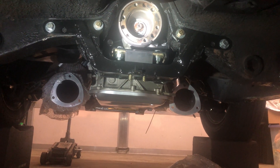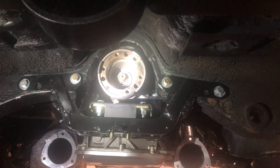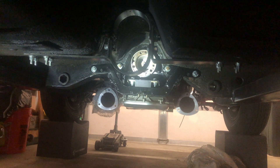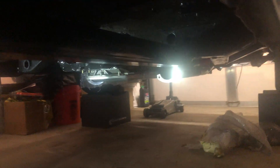Right now I have the engine shimmed up as high as I could get it, and it's sitting at about a 2 to 2.5 degree angle down - so the tail shaft is 2.5 degrees down. It's pretty good ground clearance, not an excessive crazy angle - not like six degrees down or anything. You can see from a side view everything tucks up pretty well.